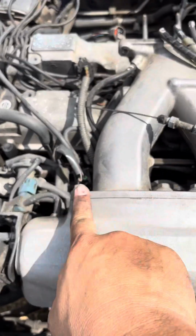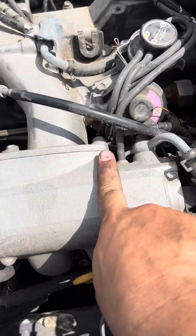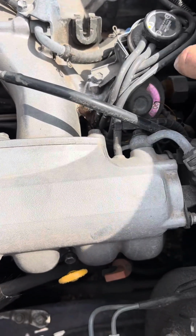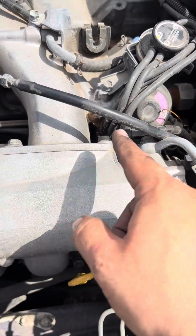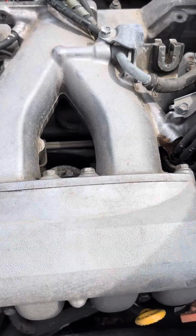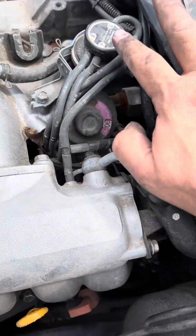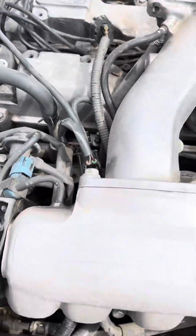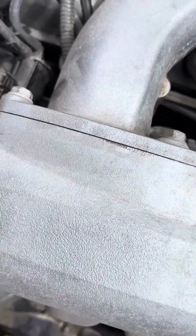And we're gonna go with 1, 2, 3, 4, right? These bolts, you are gonna wanna undo this and the EGR, but go ahead and leave this stuff attached. Take a picture so that you don't forget, or make a diagram, however you want, and remove these lines, okay? You're gonna leave that one.